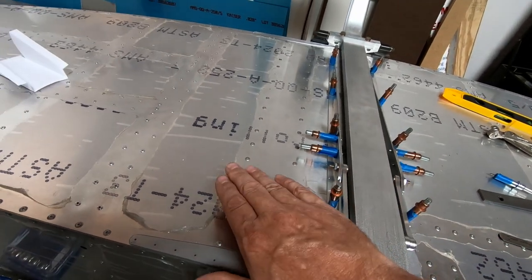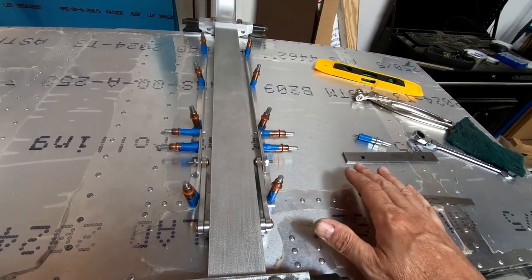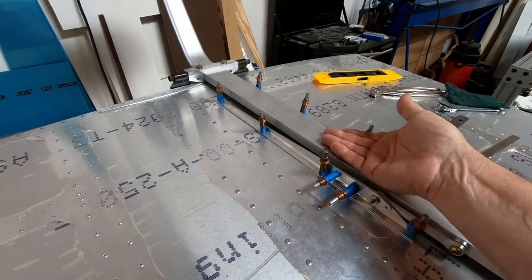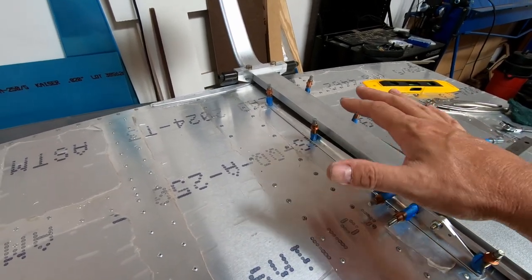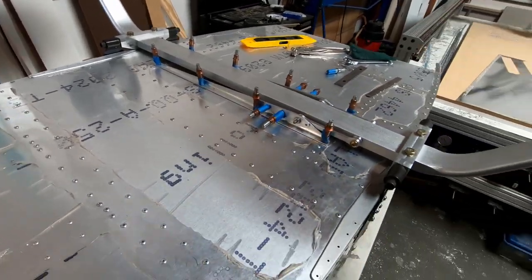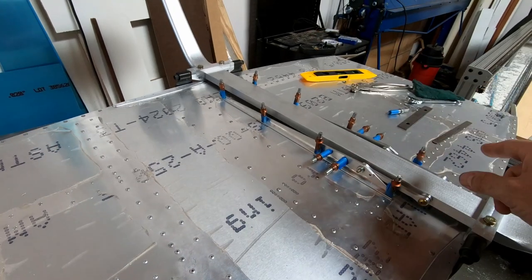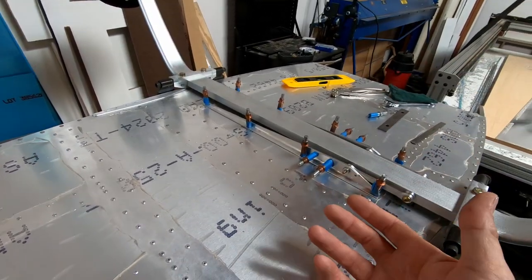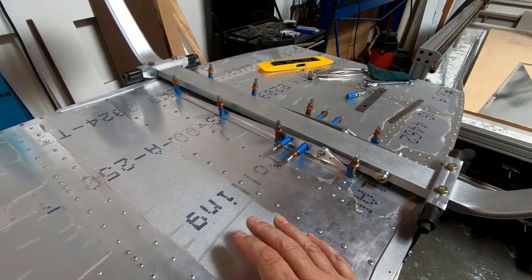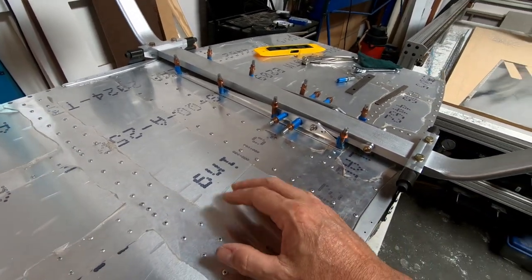The landing gear cover is relatively simple sheet metal, but it requires a rubber piece in the back attached to the fuselage so the panel can flex slightly — allowing clearance if the landing gear bends and contacts the panel. As designed, it's fully pop riveted in place with no way to remove it, but it needs to come off annually for inspection of the landing gear linkage, so screws will replace some rivets to make it removable.